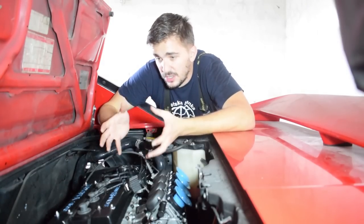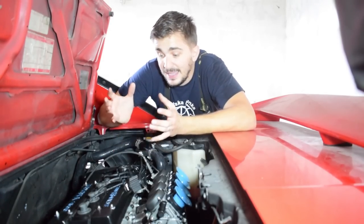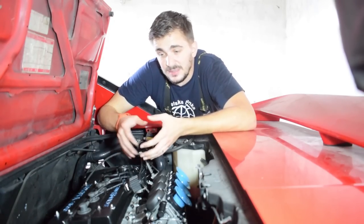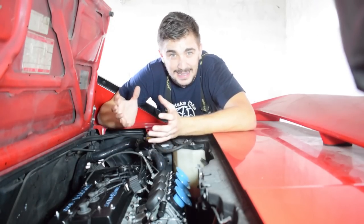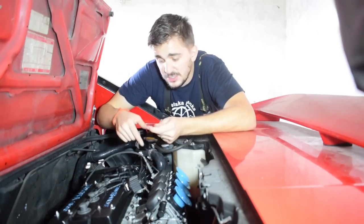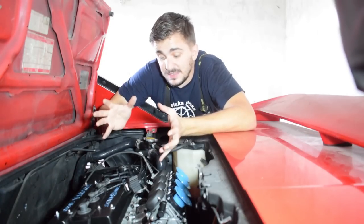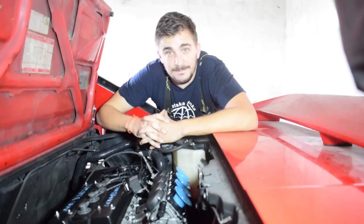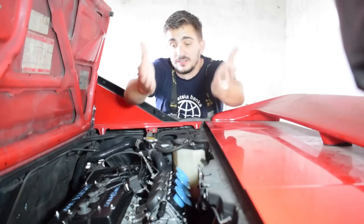I initially thought about using my stock ECU and a MAP sensor, so my intake manifold had some outlets. But I realized that running the stock ECU wasn't ideal, and I switched to an aftermarket ignition ECU. I also realized it's much better to run a throttle position sensor for load reference — a much simpler and more elegant solution than a bunch of hoses and a MAP sensor. Because I didn't think about bike carb synchronization, I plugged up all those outlets and was left without anywhere to hook up the balancing tool hoses. So I started looking for an alternative.